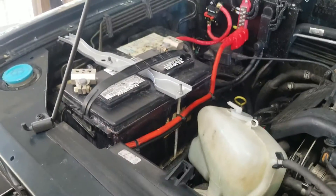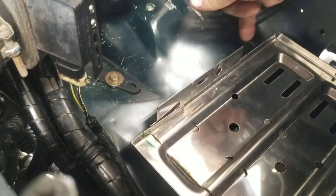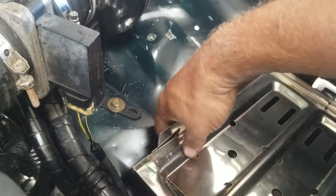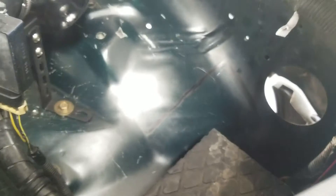From here to here is about nine inches, which is just borderline close to the OE position. I want to lower the battery a bit, so I pushed the tray all the way up to the inner fender and marked it with a black marker. I'm going to die-grind that and push it down — not cut it out, just push it down — which should lower the tray by at least a couple of inches.